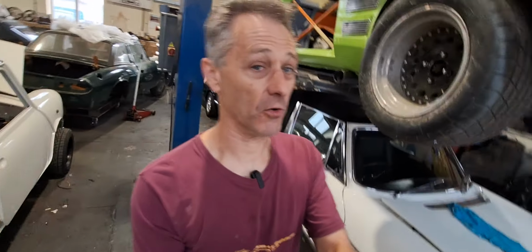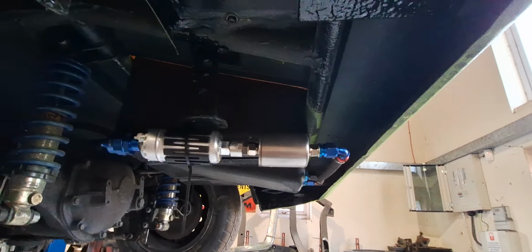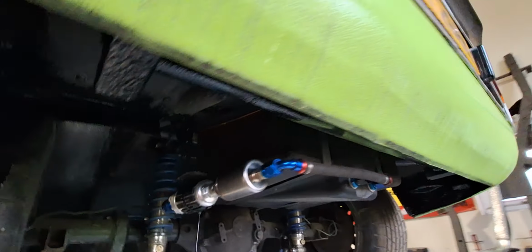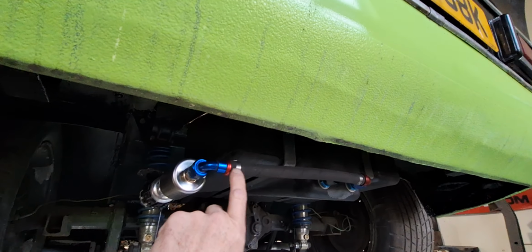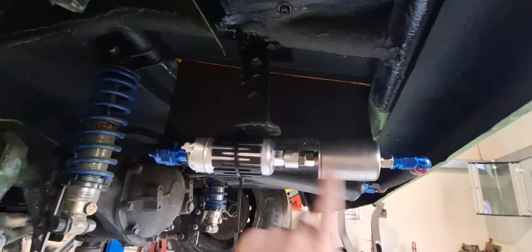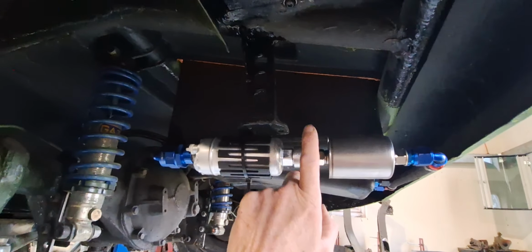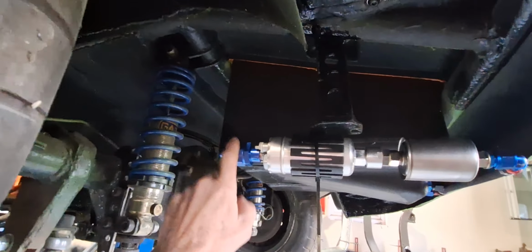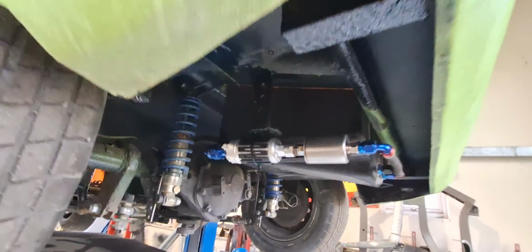On the old Capri, not a lot to show you really, but the fuel pump has turned up, and the pre-filter, those are just bobbed together there. The tie wrap is not structural, that will not be staying. The feed pipe is some ends I had just pushed onto a piece of pipe, and I've clipped it here. I don't think you actually need to clip those, but I've clipped it anyway, just to be safe. Had to wait for a few fixtures and fittings to come in between, so adapters to go from AN6 to M14, and then M14 to M18, and then back down to M14, because you can't get a male-to-male M14. And a one-way valve at the end, which goes from an M10 fine to a -6, AN6. So that's my fuel system.